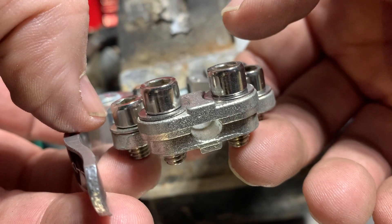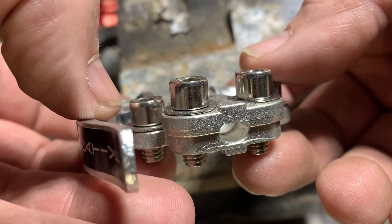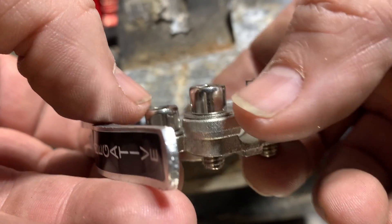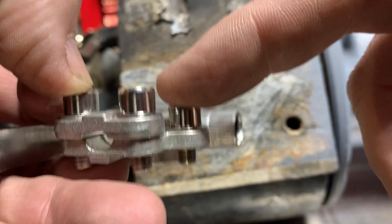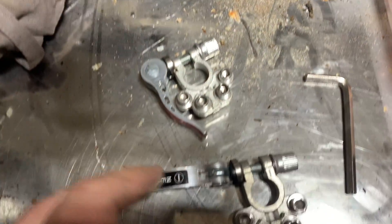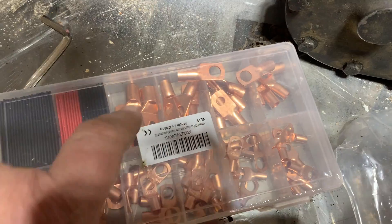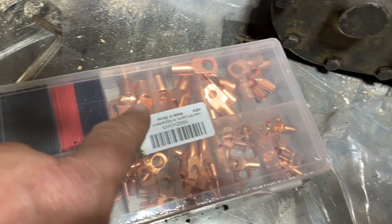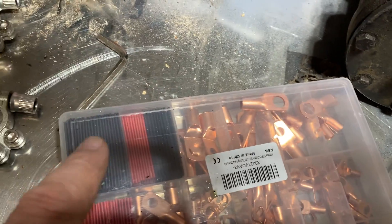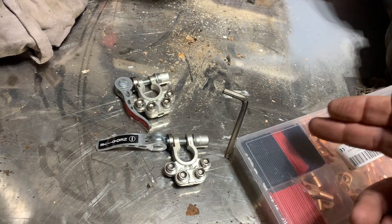So I've got a winch on the red Jeep outside, and I put the winch on one and I have a ground on the negative out there. There was a ground for something and it was on, so I put it on the other side. And I goofed because I put the winch - I cut the cable on the winch - so I stuck it in there and then I put the actual ground from the motor here. I've got to fix that. There's the negative, there's the positive, there's a dirty bench - at least you see it's got work on it. And like I said, the ends you need - I just bought a kit, so I've got all different sizes, different holes, different everything. And then on the cables, I will solder these on for a positive connection. Then they give you a shrink wrap - don't know if it's the good shrink wrap or the not-so-good shrink wrap. So then once you're done, you shrink wrap it. Red on the red, black on the black. Easy, easy stuff.